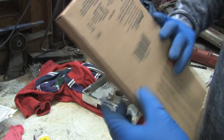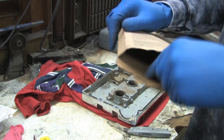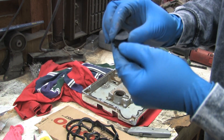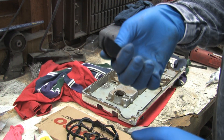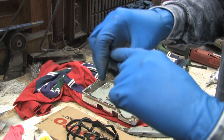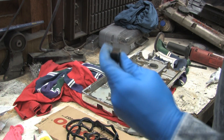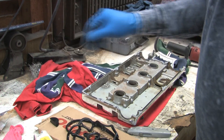I'm just using a Felpro gasket — there's the part number for you. This came with the half moon seal that I don't need because I've already replaced it with the aluminum Evo seal. But some of you guys have this rubber seal still in place. This needs to go into the head, and you need to apply RTV to the joints all the way around the bottom and the top side, as well as a small stretch where that matches up on top of the head before you install the valve cover. That keeps that from leaking oil.